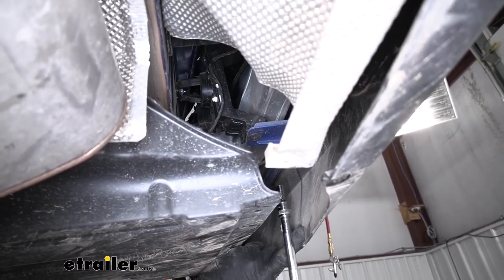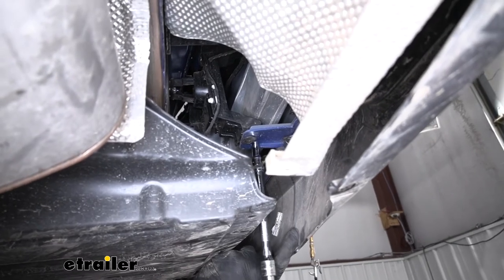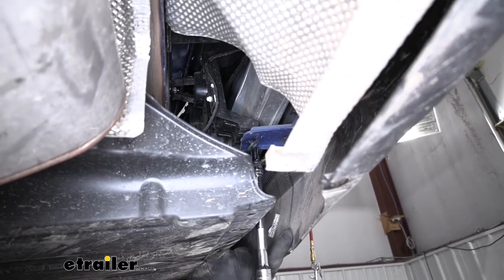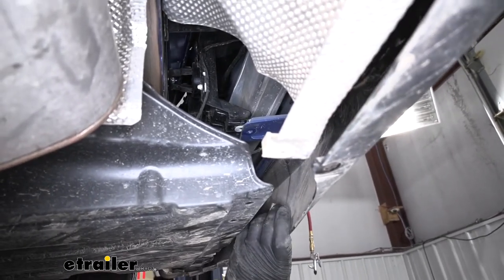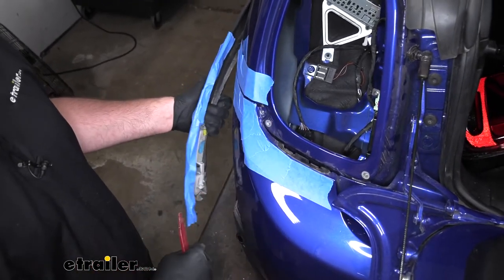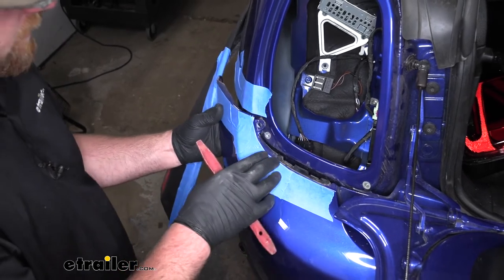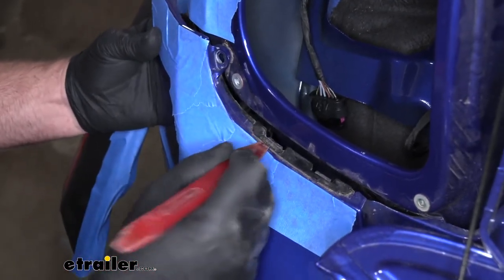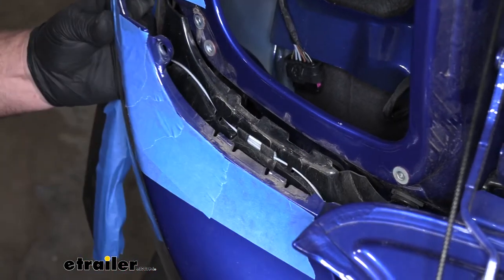If you move underneath our vehicle and pull out on your bumper trim towards the passenger side, you're going to see a piece of plastic that comes out with a bolt on it — you need to pull that bolt out using an 8mm socket. Then we can start to actually get our fascia pulled off. I've used some painter's tape around the edges where we're going to be working so we don't accidentally scratch up our paint. Starting at the corner, just pull out on it and we want these fasteners to release. You can take a trim tool and get underneath there to pop those out.